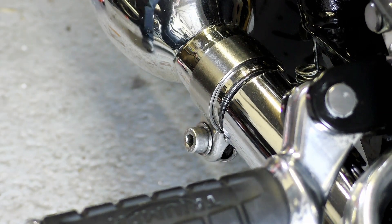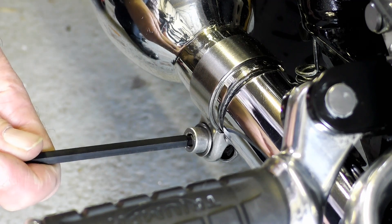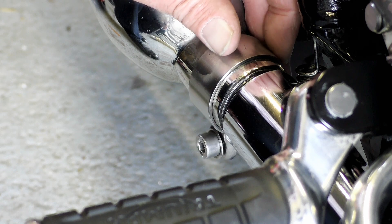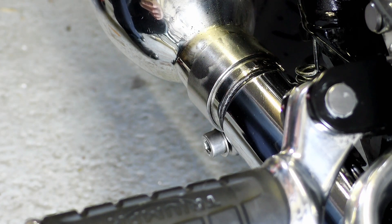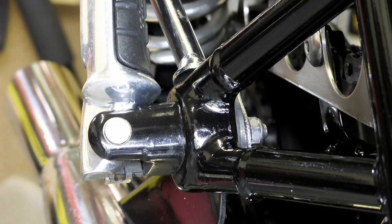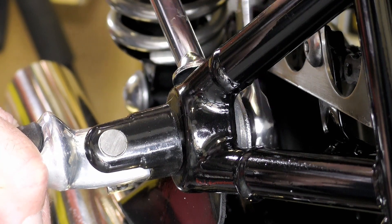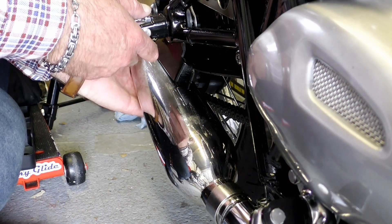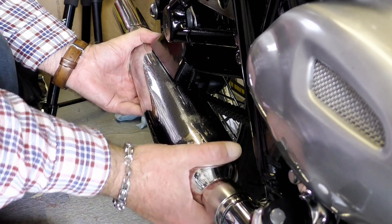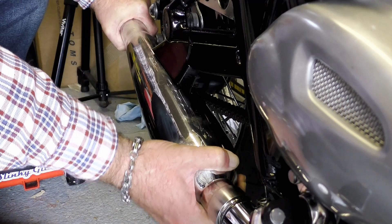Starting on your right-hand silencer, which is the easiest one to do, use an allen key to loosen off the exhaust clamp — make sure it is good and loose because when you start moving the silencer later on you might reach a tight spot. Once you've done that, remove your rear right-hand foot peg by getting a spanner on the nut at the back, pressing down hard on the foot peg while it's unfolded, and unfastening the nut. Remove the foot peg and the bolt that holds it in place — this also holds the silencer on — and while you're doing this, support the existing silencer otherwise it will just drop as the bolt comes out. Then with a slight twisting motion, withdraw your silencer.